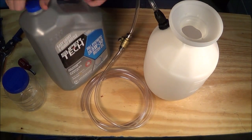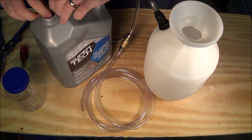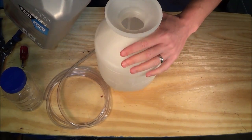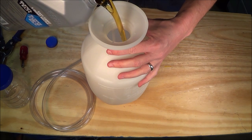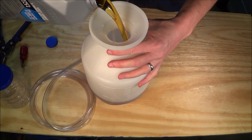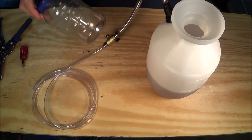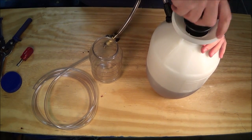To demonstrate how well this works, I'll unscrew the top of the garden sprayer, set it to the side, and pour in some regular motor oil. It will pressurize very quickly and do all the work for you — especially if you're filling transmissions or transfer cases, this really makes it easy. Just pour the fluid right in the top — I'll fill it about halfway. I have a small clear jar here so you can see it being filled up.